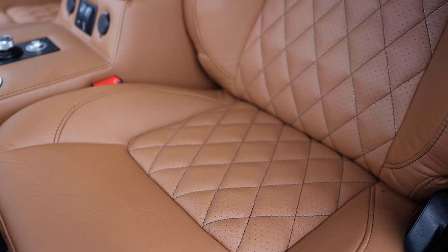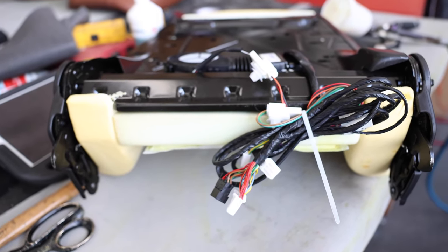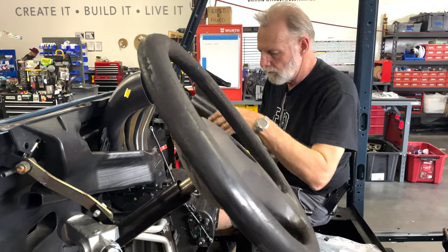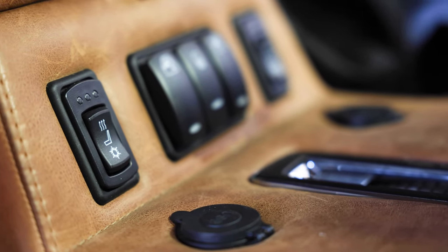Another option that we have is strictly heated seats, just like the original OEM seats, and also heated and ventilated seats as an aftermarket option. The heated and ventilated system has a little fan underneath — you turn the heat off and it blows air up through the cushion and basically cools by convection. When everything is installed and the AC is charged up and turned on, it works just as well as the original, if not better. If you want heat, you turn on your heat, and if you need a little more heat on a cold day, you just turn the switch on for your heated seats. And if it's a hot day, you can turn on your air conditioner and chill down, because nothing feels better on a hot day than air conditioning in your vehicle.